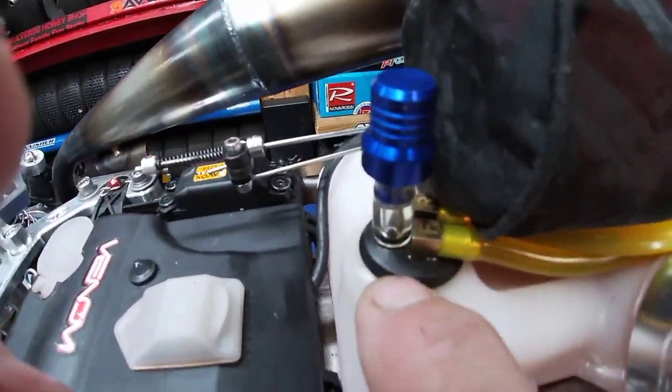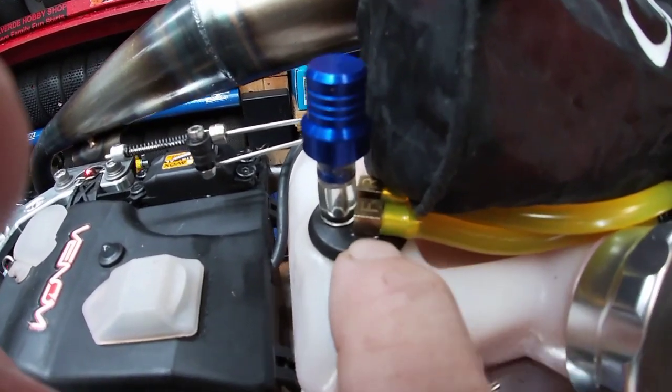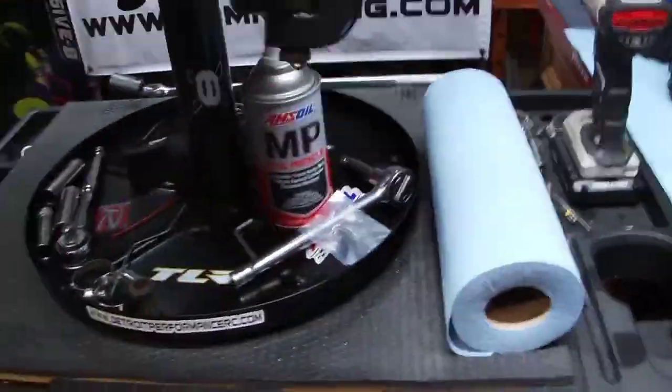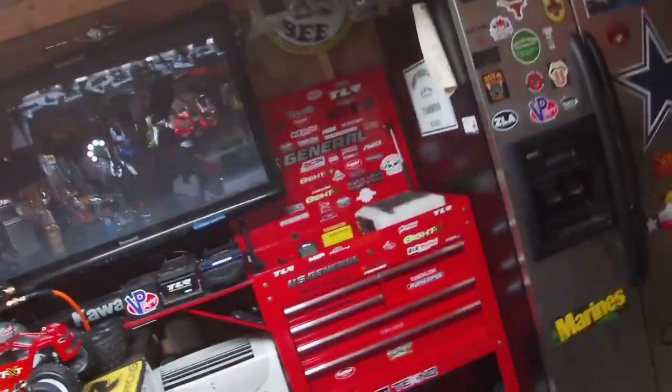With the light flywheel and all that, we did finish getting the Snappy RC grommet in. I'll tell you what, once all this was put in here, this thing was tight getting in. It was hard to get in, but we got it. She's good to go. I actually did use the full force, or these aren't the full force ones. I think these are the Losi ones that came with the kit. Same thing though. They're the same brass fittings that Full Force uses right here. It's just these are round ends and these are square ends.